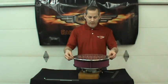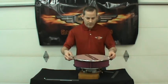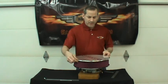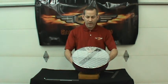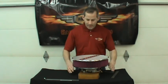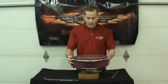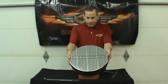Basically I want to fit my air filter and as you can see it just locates kind of right nice. I just start spinning it — the air cleaner itself is my nut — and it is starting to lock up. Here's what happens: let's say it started to tighten up — you would realize that you don't have that far to go. If it was starting to snug right here, you can have a little pressure on the carb and the base, and basically you just tighten it on up until it's snug facing the front of the car.